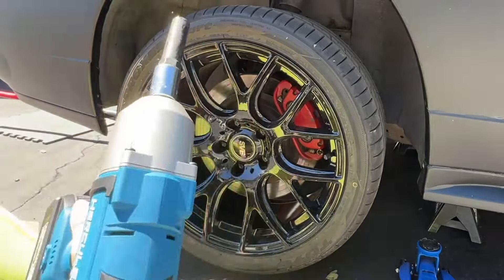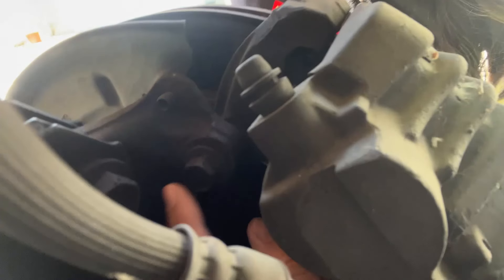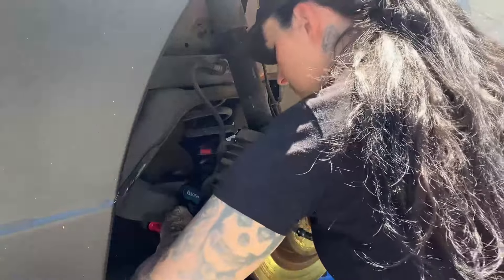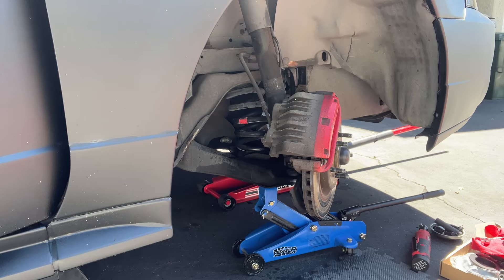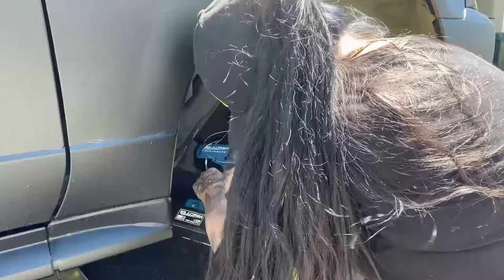I had already lowered the passenger side, so getting the car jacked up is a little bit of a challenge. Those caliper bracket bolts are like fused on. Learning from the other side, I had already gone to Harbor Freight and purchased impact tools — I was just too cheap before. The trick was turning the wheel, which made everything a thousand times easier. The bottom bolt came off no problem; the top one still had clearance issues, but I used some choice words and eventually got it off.